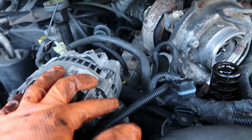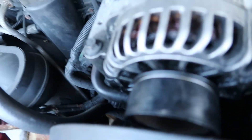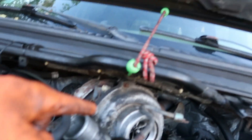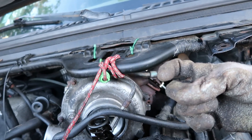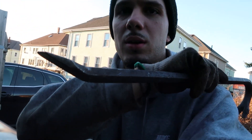Next up, we're going to get the alternator out. These are 13mm — crack them first and then use the tensioner to loosen the belt, then pull it right off. Now get the alternator out. There's a 10mm down there — take those 10mms out. Then remove the V-band from the exhaust attached to the back of the turbo housing. Don't forget there's another 10mm on the back side of the turbo — only way to get it is from right in here. Get a 10mm wrench on there and pry to get enough leverage with a bar on the back of the turbo.